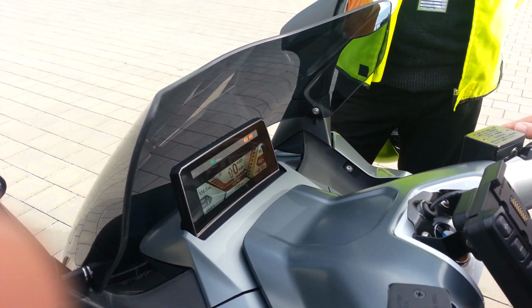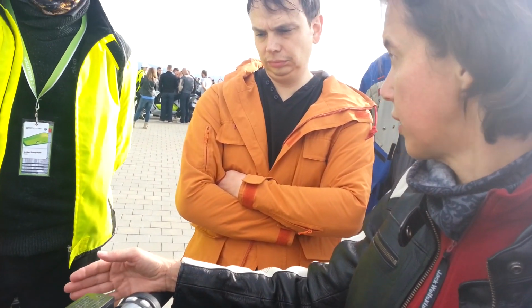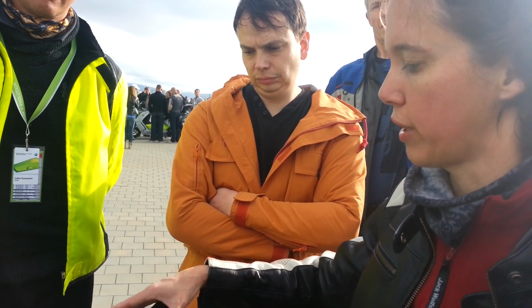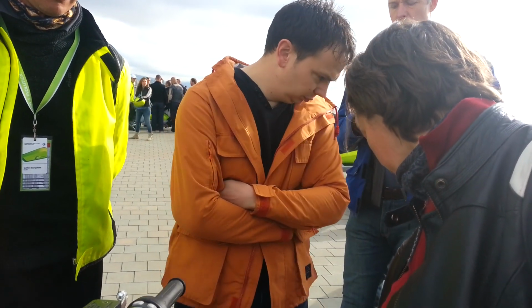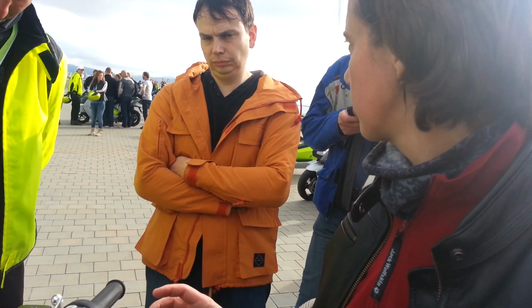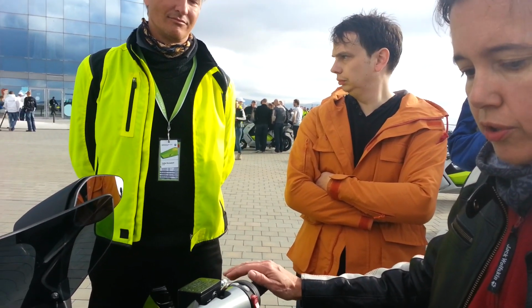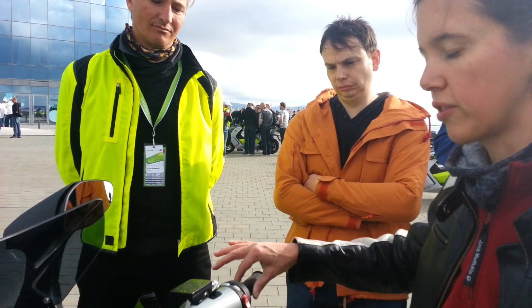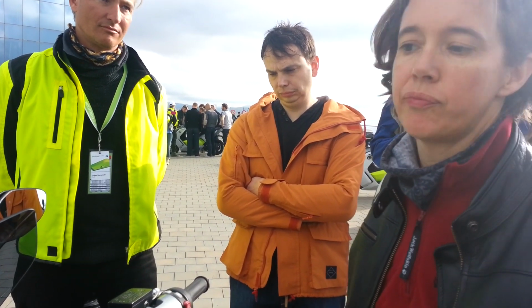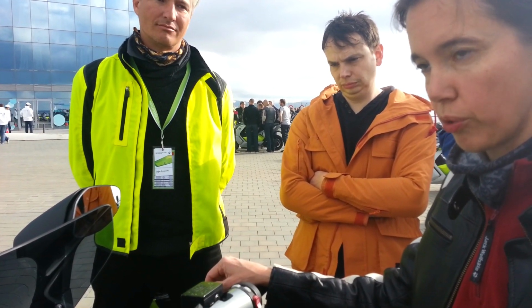We recuperate energy every time we activate brakes. There's an additional brake pressure sensor in the system compared to combustion engine scooters, which as soon as it measures, okay, braking is on, adds an engine brake, a simulated one. The engine turns generator and feeds power back into the battery. The second moment we recuperate is when we just leave the throttle and coast along. Then also we have an artificial engine drag, which feeds energy back into the battery. But that is depending on the riding modes, to which I will come in a moment.